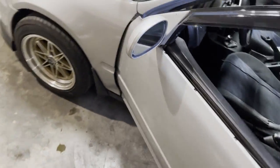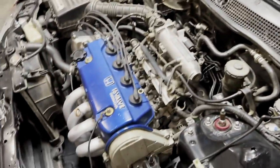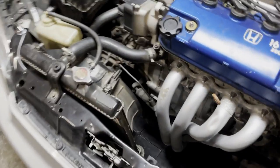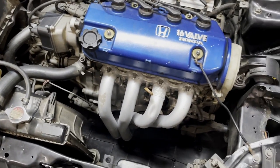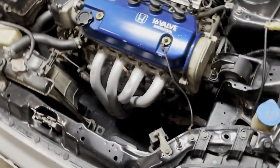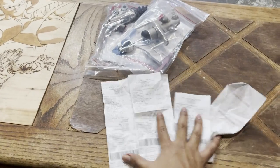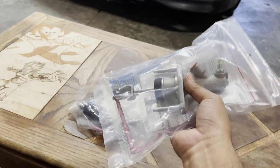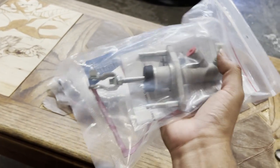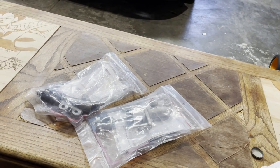So now I have to take out my master cylinder and replace it and bleed it to get any air out of the system. I'm also going to be replacing the slave cylinder just because it wasn't that much of an expensive part, and I figure while I'm doing it I might as well get this one done as well. So after three separate attempts at the store, three separate receipts, I finally get the one I need - the other ones were totally different. After about an hour of killing time there, I can finally get started on this job.